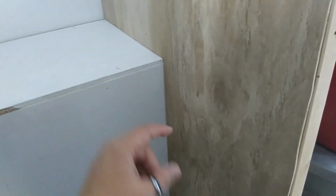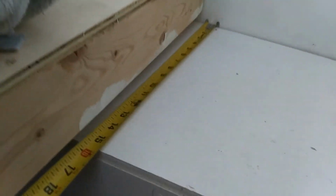I'm going to measure the height of this wheel well, then the depth, and that's going to help me figure out the placement of this wall so I can start the curve. It's kind of hard to see, but it curves out pretty well. I think 2 or 3 inches at the deepest part. So once I get this wheel well measured out, then I kind of have a square place to start, and I know where to start the curve. I have 21 inches tall. The wheel well is 21 inches tall. And then to the wall, we have 15 5/8.